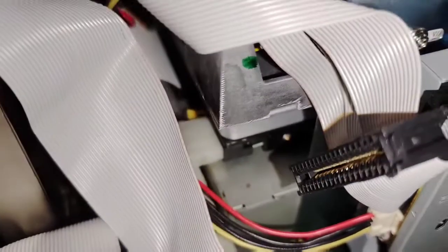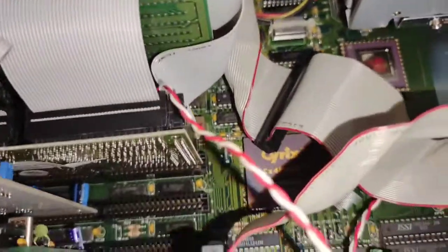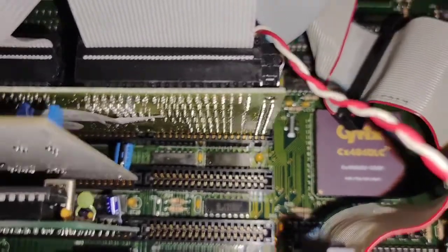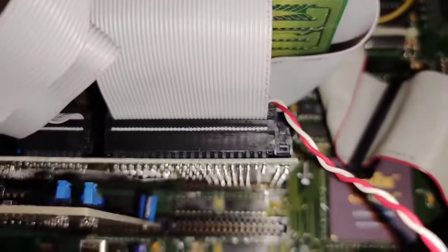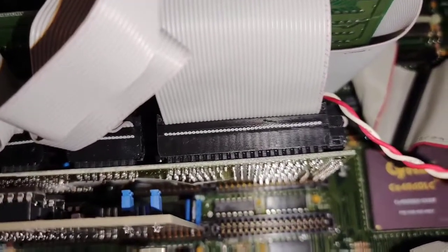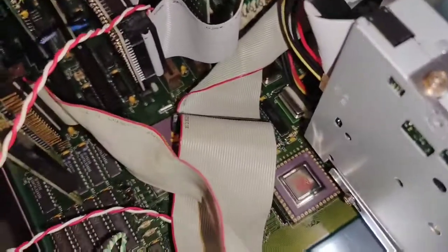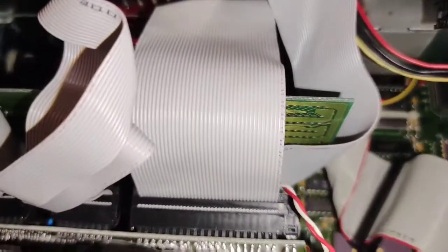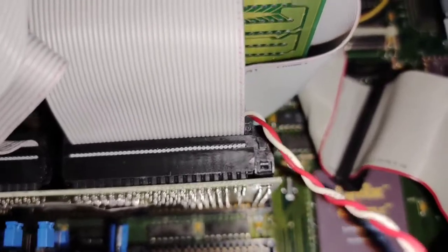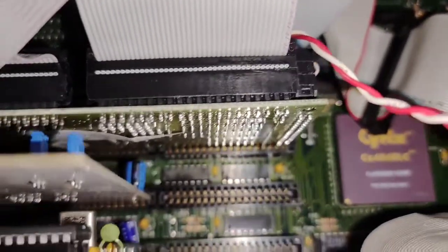I got a Western Digital WD43AA hard drive. This computer does not support logical block addressing — well, the BIOS doesn't. It supports up to 504MB because of the lack of LBA — logical block addressing — which was introduced on later 486 machines. The early 486 motherboards also had this limitation. But there are IDE controller cards with enhanced BIOS, like the SIIG variants, that can help — though those things are hard to come across.